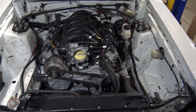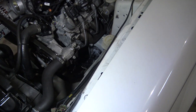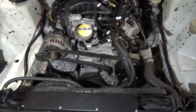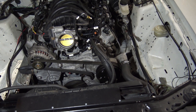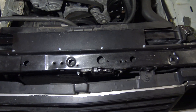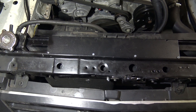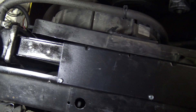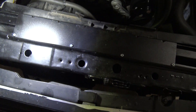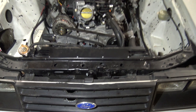The L83 is running, everything's good, almost completely buttoned up. The only thing I need now is a dipstick — I still don't have one. The one Holley recommends is not in stock anywhere, so maybe an LS3 one works; some of you guys can answer that. Fans are good, and I used a leftover server cabinet hinge piece that works beautifully as a radiator mount for the top — it sandwiches in between the rad and the fan, and I put tiny little self-tappers in there. It looks neat and tidy.